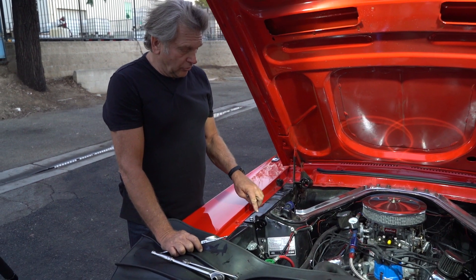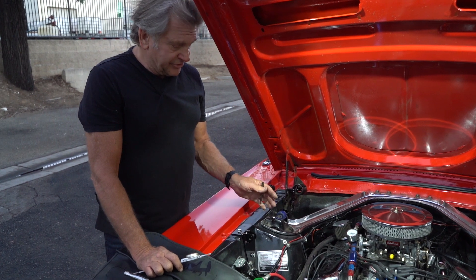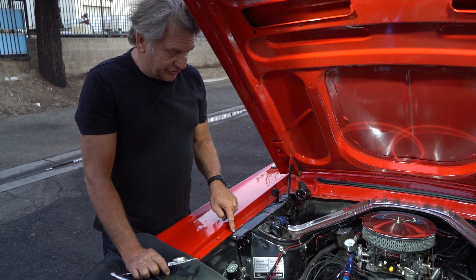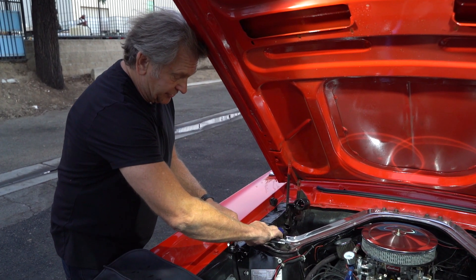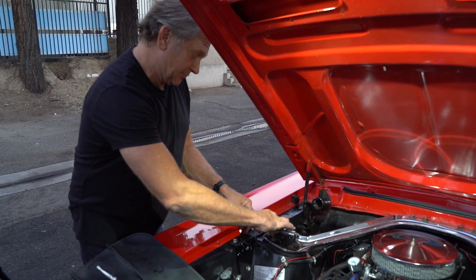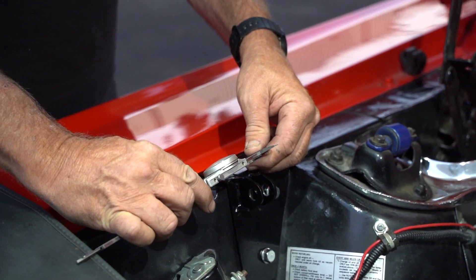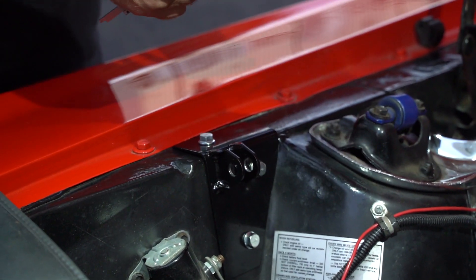What I'm going to do now is drill a hole here in this top plate for my final bolt. There are a number of ways you can do it — you can position it anywhere you like. But what I'm going to do is mark it off the same distance of what this is in relation to the top plate. I have a caliper here, which I'll take over and do centerline, catch the edge, and do centerline of the bolt. I'm going to do a slight etch into the powder coat — doing the same thing here, catching the edge of the forward portion of the bracket, centerline of the bolt, swing it to the back, do a quick mark — and that's where I'm going to drill my hole.